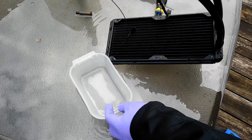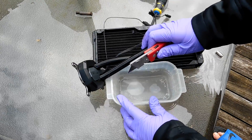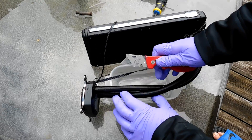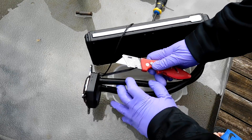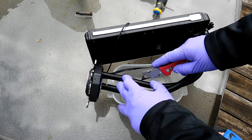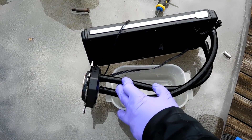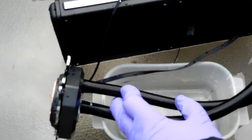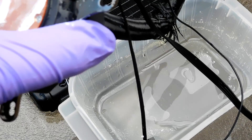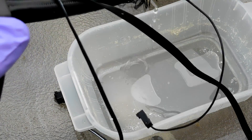We're going to drain it here. When draining a liquid cooler, look for a couple of things: basically just look at the color - is it different from when you put it in? If it's an all-in-one, is it different than what it should be? It might be discolored, it might have some little flakes or scales in it, and if you see any of that, it could definitely mean that you have a clog somewhere or that the flow of water is being restricted.